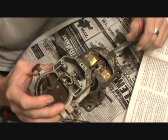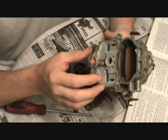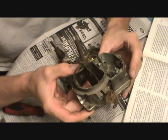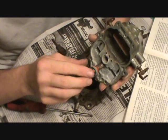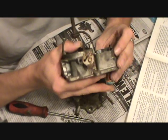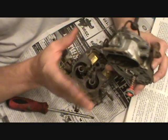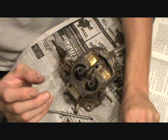This thing is nasty inside. Now when you turn this thing up, you're going to see on the bottom — this is the accelerator pump right here. It's got a little piece in there. We already took that big rod out of it; that's what works it. It's got a spring on it, and there's going to be some way that it's captured up here. I see it — it's got a little link on it. So I don't have to take that down yet. I'm not going to do it until the step calls for it. We'll just set the air horn to the side right here.